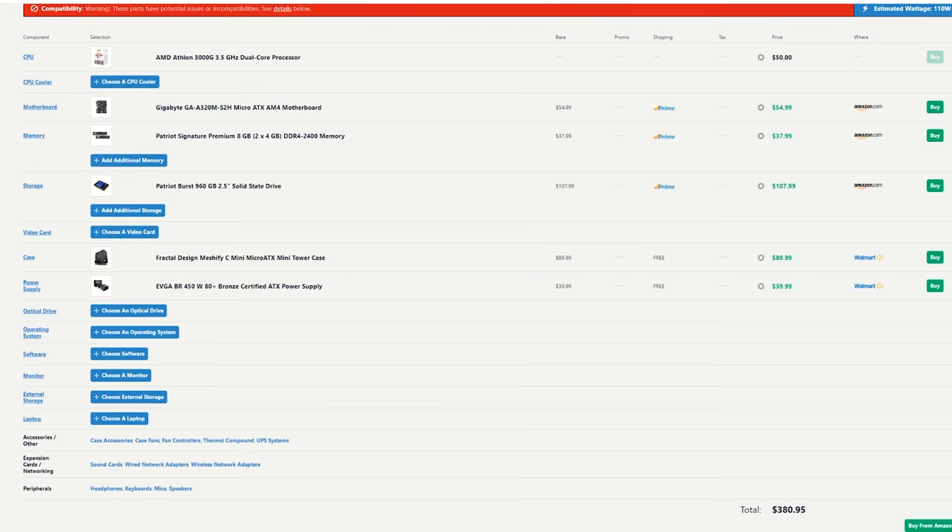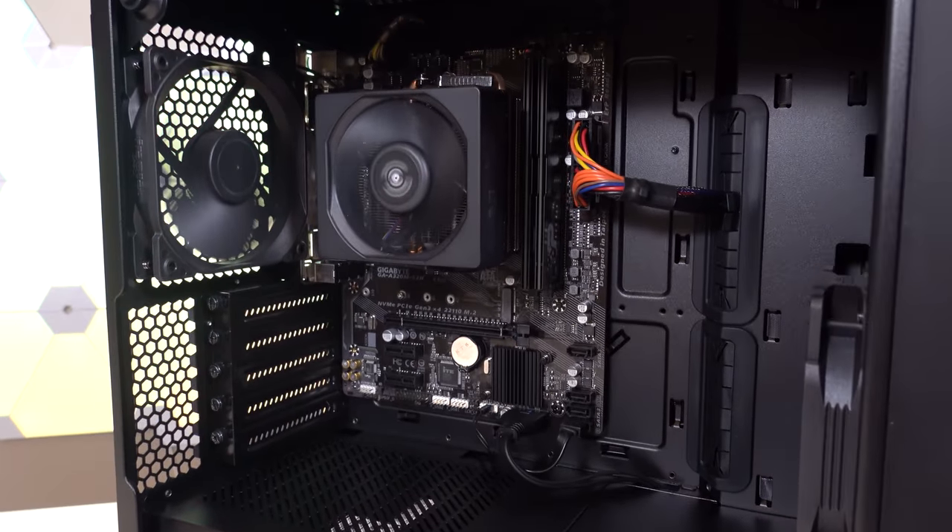That's not how we operate here on this channel, and I wanted to see how cheaply I could put together a build that we could still technically game on. What I said in the intro about this sort of being a sub-$300 PC refers to two parts that I used that you don't need to. As is, this box is actually about $380. However, a huge amount of that comes from the $90 Fractal Meshify C-Mini and the $109 Patriot 1TB SSD that I'm using for storage. If you are parting out a build like this, you can very easily chop both of those numbers in half — pick up a case for $50 and a 500GB SSD for $50 instead, and with the rest of the parts exactly the same and performance unaffected, you've spent less than $300.